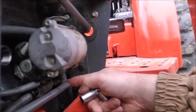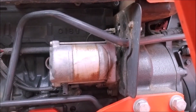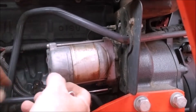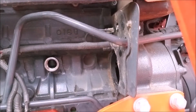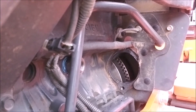There's one bolt down here, one bolt in there. That's the bottom starter bolt. The instructions say to lightly tap the sleeve with a plastic mallet to get it into the block — I got news for you, you ain't getting that in there with a plastic mallet. This is a 22-ounce framing hammer and you can see I'm hitting with a fair degree of force. Ain't happening with a plastic mallet.